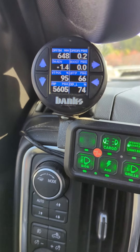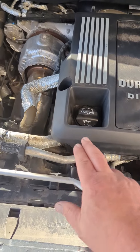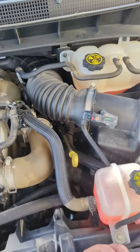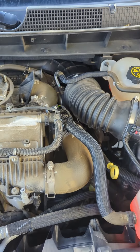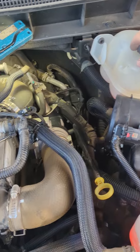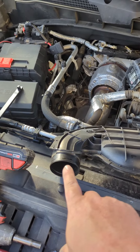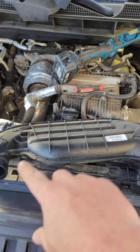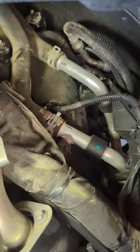So we're going to dig into this and see what we can find. Got to pull the oil cap, 10mm bolt. I'm going to unhook the battery too, just in case. We're going to pop this air pipe off — 7mm, 7mm. I pulled this coolant hose off. This coolant tank just sets up against the firewall. Pulled it loose and then pulled the intake pipe off. 7mm back at the turbo, shallow well. It's tough to get into, but get that pipe wedged out of there — that's the next step to get to the sensor right in there.